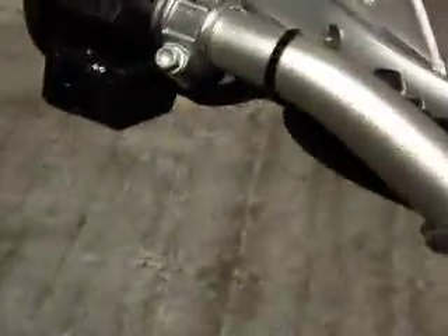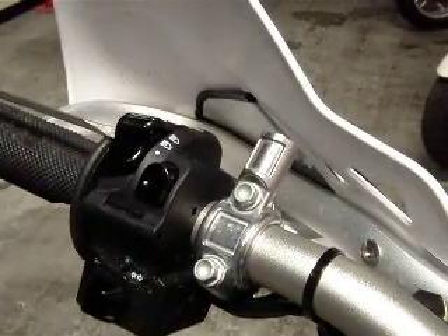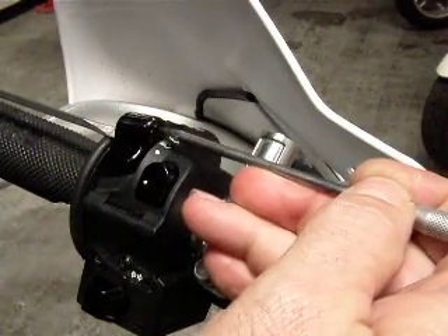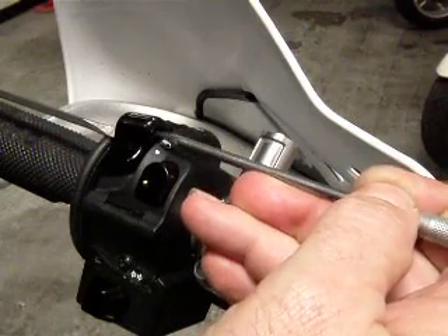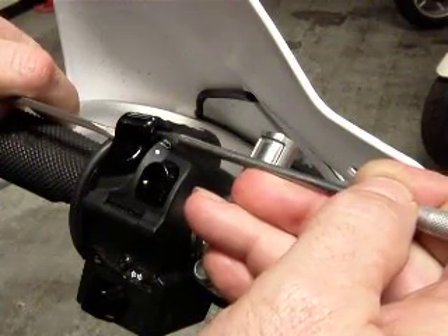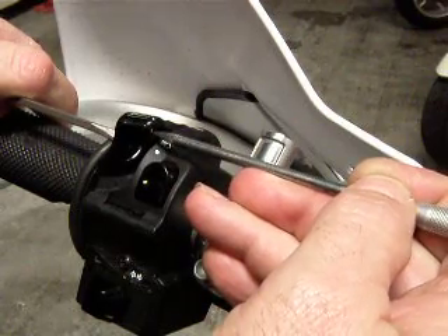I'm going to put the camera onto a tripod and make it steady. Just inside, if you look from this angle, there are two little white clips with a space down the middle. On each one, you're going to pull this pin in and pull this pin in, while applying a twisting pressure with your small flat blade screwdriver.